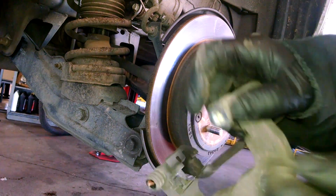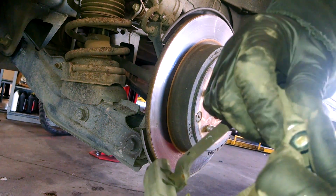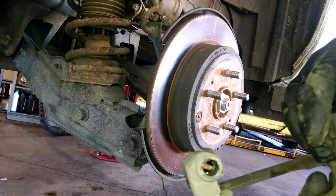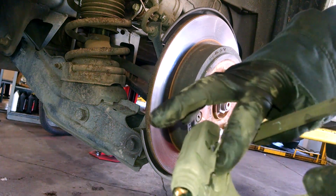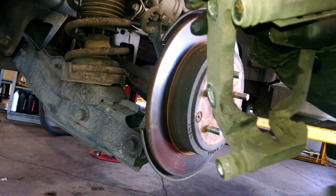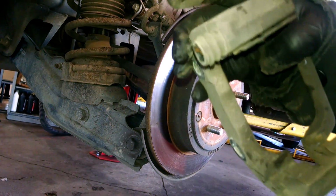Get some brake lubricant so you can lubricate the slides. Even though they slide pretty good, you should put a little bit more on there. Just a little more lubricant in the holes. You can clean these up with a rag or something, or a little wire brush, or replace them if you get new ones, they just kind of clip, snapping out, friction fit. Clean them up or replace them.